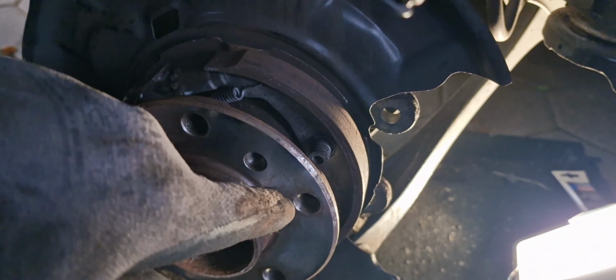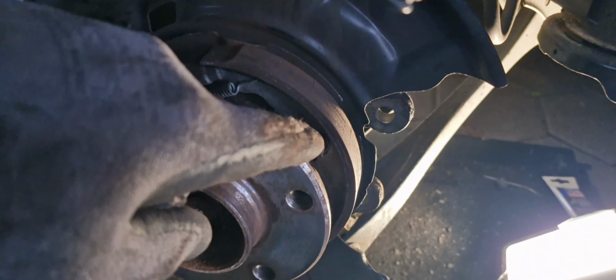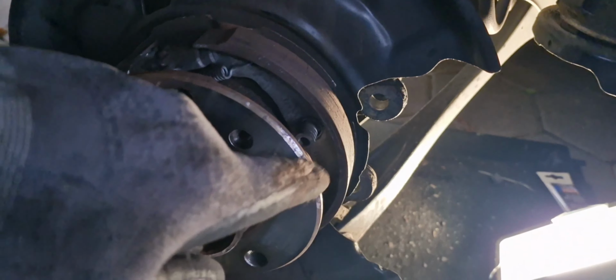So guys, it's out. But what I realized also, it has the contracting handbrake inside. These are brake parts, but only used for the handbrakes. I'm just too late to realize I could adjust the handbrake to squeeze inside so that I can remove the brake caliper, because it took me a lot of time to remove it. I was really wondering, the handbrake is down, but still the pads here are holding the drum inside, so it's not really coming out.